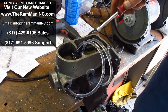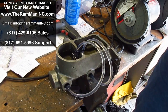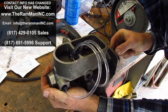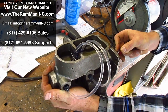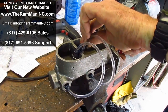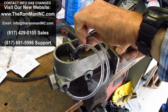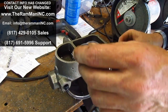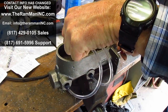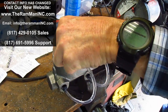We're going to check and make sure this master cylinder bleeds correctly and releases — I think we'll find that it does. There we go, got really good fluid flow. These snout master cylinders with their extended stroke typically work very well. And here we go — got really good flow out of there.